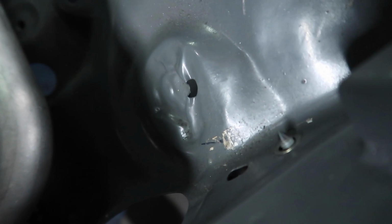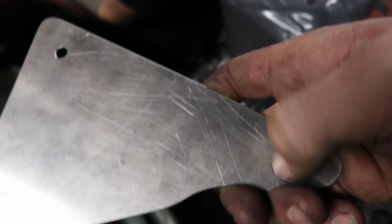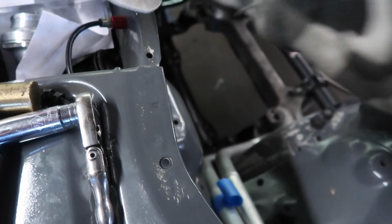It is on the back side and back of it. So then it's right there. And when you lean your panel up against it, before there's any holes, you line up the panel how you like it, and then bam, you hit it. And then it's a reverse center punch, and then you'll have your pilot hole or your center punch hole to start drilling. You drill it out, and then you bolt it in, line up where you want the next one, so on and so forth, and then all three of them will just go in place.